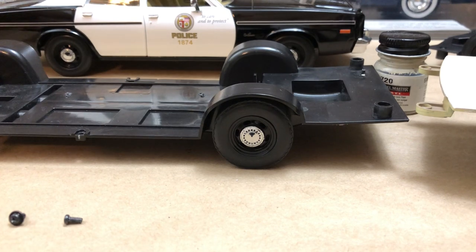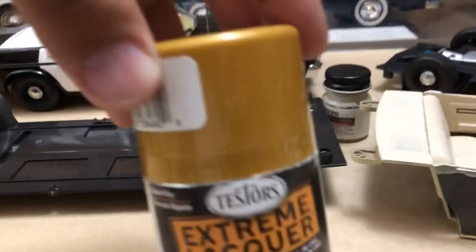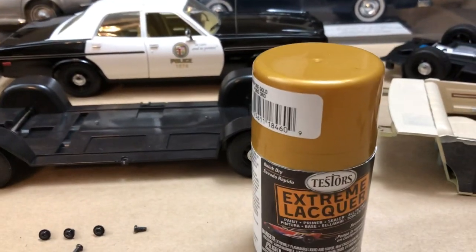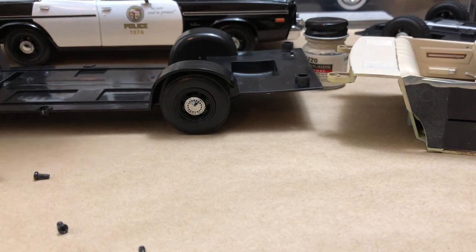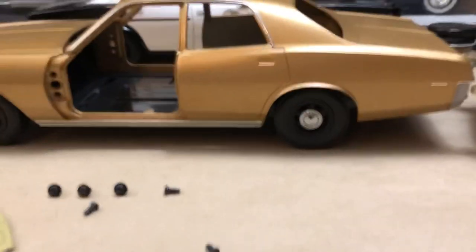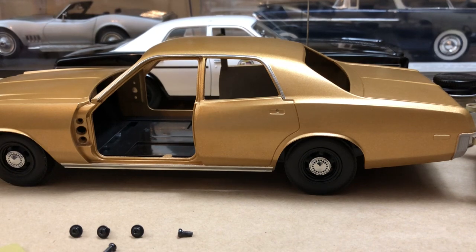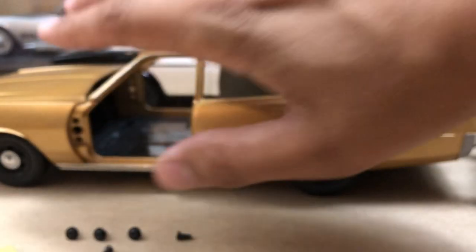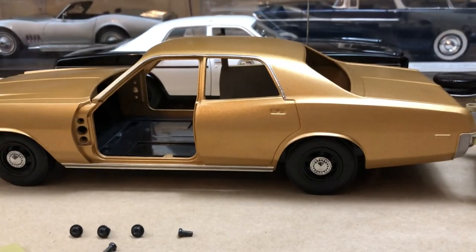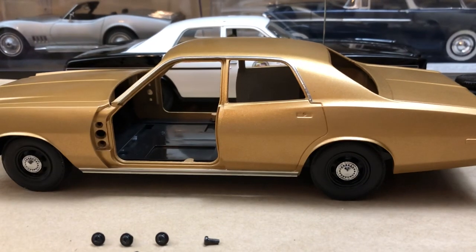So that's the interior rundown — the stuff I'm going to be doing for the chassis. Now let's get to the body. I'm using this color — believe it or not it looks a little bit lighter on the cap, but when I saw it in the store I was like, that's the 1970s color I'm looking for. I did a test shot, liked it, put it on the car. It's called Pure Gold. Even though it says all-in-one, I did lay down primer first. This is the second coat of paint — I did sand in between. So the process was: bare metal, sanded, coat of primer, sanded, another coat of primer, wet sanded that, then color, and now I'm at the stage right before clear coat.